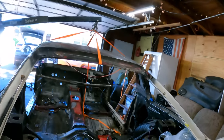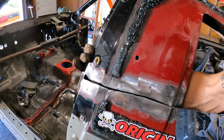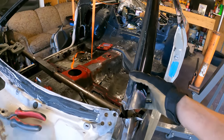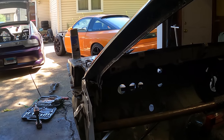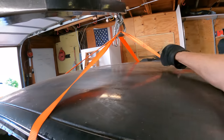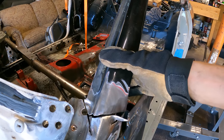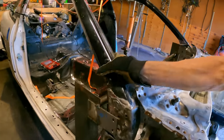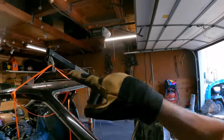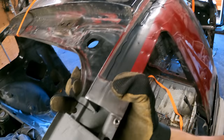It's lining up pretty good. Looks like I need to lower it a little bit more. I took off some of the tension from the hoist because I still need to move it around — but it sits in place really nicely. The first thing I want to do with aligning the roof is try to match up the jig to the door holes on the A-pillar, because then everything else should be in its correct spot.